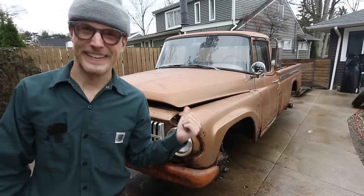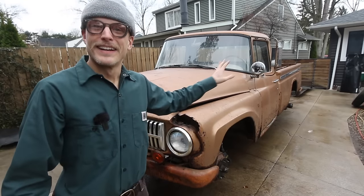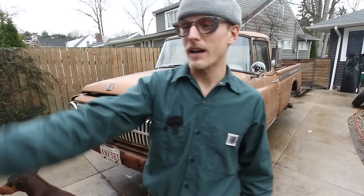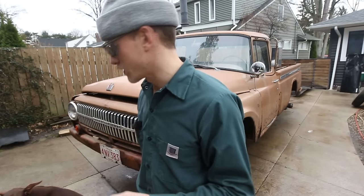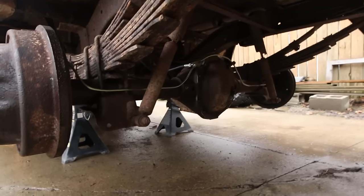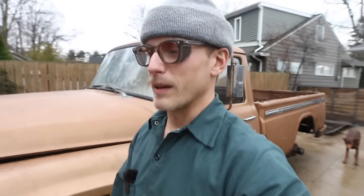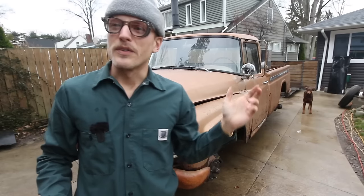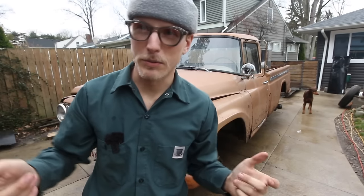Welcome back to 'where the heck are we on this thing.' I bled the brakes — that should have been a quick process, but to be honest that was a few days ago. I was chasing my tail with leaks, air bubbles, and couldn't get it working with my pneumatic bleeder. So I had to bring a buddy over — thank you J-Rod for stopping by and pushing the pedal. We got it licked, I think. The rears currently have a full new line going across the back because I discovered a pretty severe leak — pinholes and rusty lines. I fixed up a new hard line back there and had to basically start the bleeding process over.